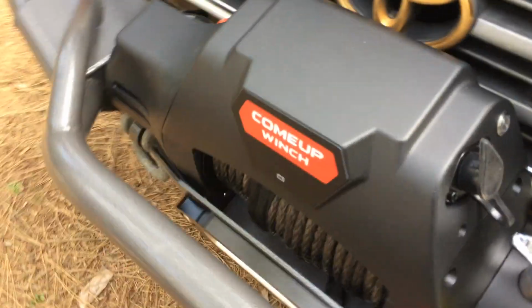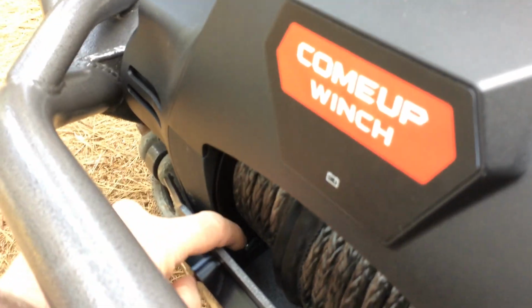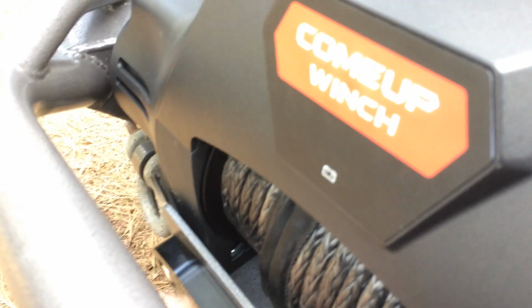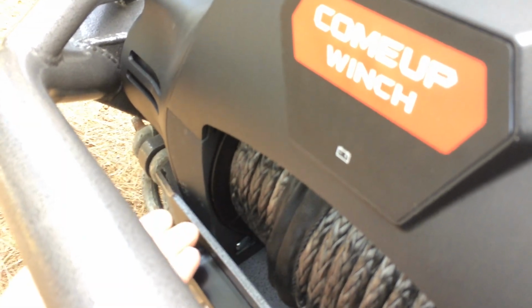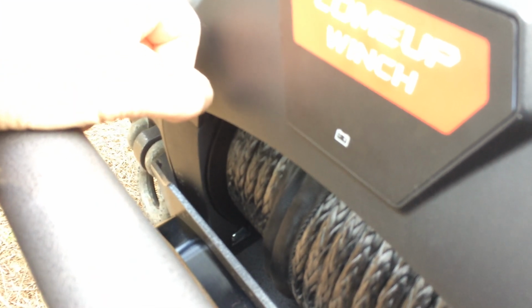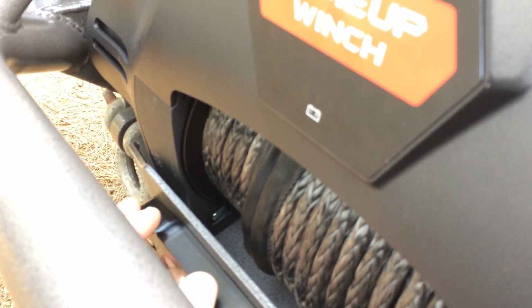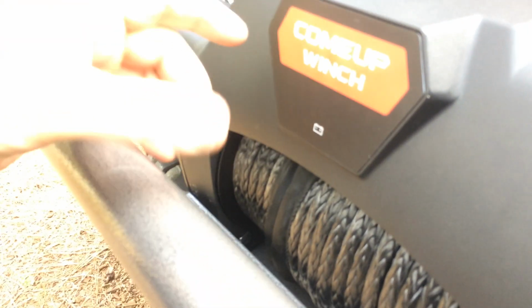The little square nuts that are down in here, you can see the shiny silver color. That's one of the square nuts. They want to fall out of their little slot that they slide into. So I put a piece of tape over it, some painter's masking tape, a little piece on all 4 of them. And then when I was threading them, I realized once you feel like you're getting a bite, take the tape off and make sure they're aligned right and you don't have one cocked sideways, because if you do, you could misthread it and get a cross threading. So if you put tape over there to hold those on, take a little tool, and the tool I was using was a little mechanics pick tool.